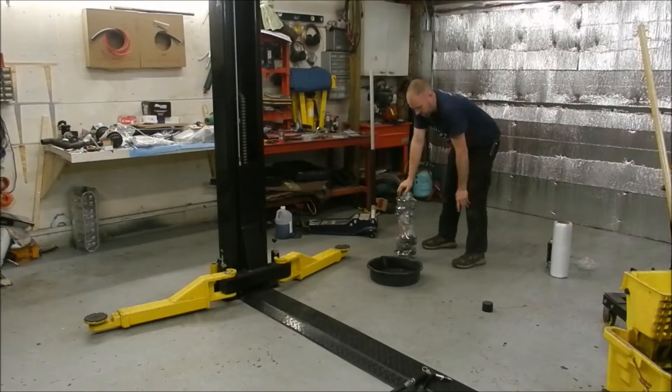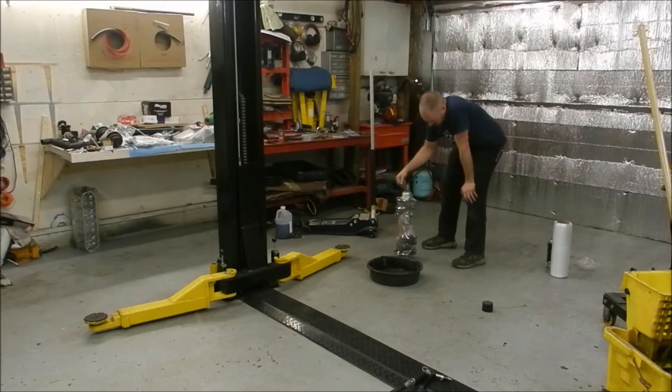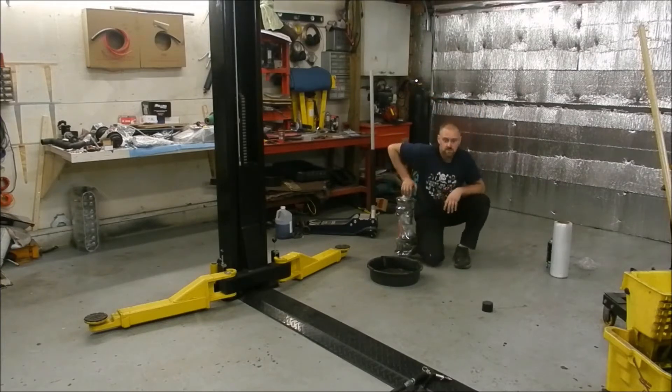So I'm going to leave this part wrapped for now and clean it later. I have to cut the keyway into here for the balancer, so I'm going to do that before I actually clean this off because that's going to create some debris. Notice how I'm wrapping everything in cellophane or saran wrap — after I clean it, it's to protect it and keep it from getting dirty while I do other things, because I still have to clean the shop up some more. I'm basically just trying to prepare as much as I can for the engine assembly.